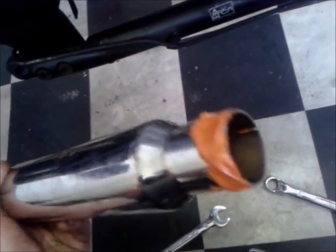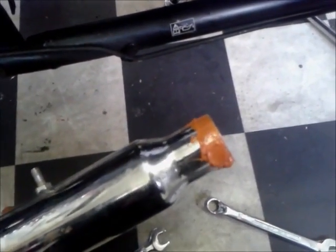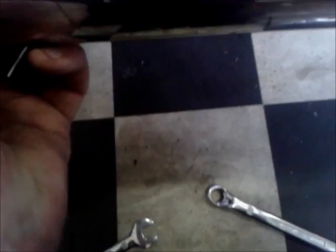Right, it's got the slots drilled in. I've just tightened them up in the vice a little bit to chamfer them in, and now for the insertion, so it's really lubed. As I said, I've just got the sealant that makes it look like my pipes are rusty rather than the nice black stuff, but you've got to use what you've got. So here we go. Rubber mallet.